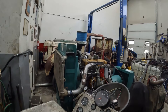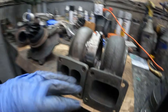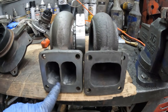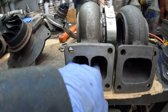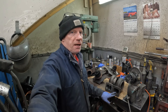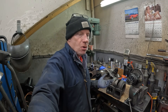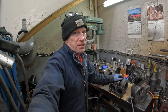So that turbo on the engine is 66/65, running this housing right now. What we're going to do next after this dyno run with the new blower is put this housing on it — I want to see if this accelerates any faster, is it any cleaner? The argument is on a Detroit you need to run open housings. Why can't you run divided housings? I know all the four-stroke guys do it and everybody swears by it. So I'm going to test for myself — is it true, is it not?